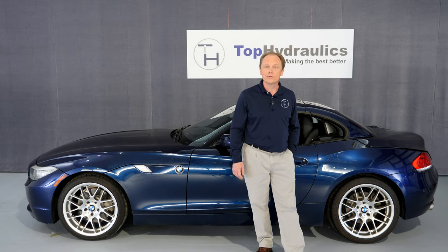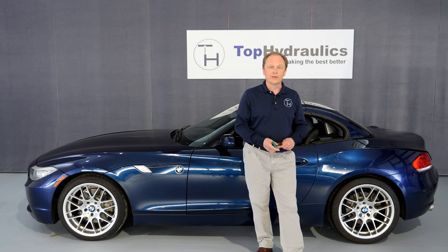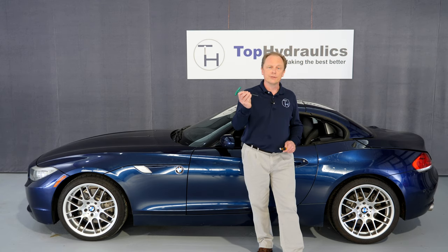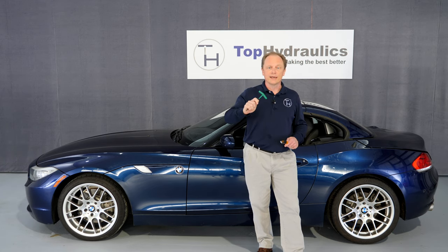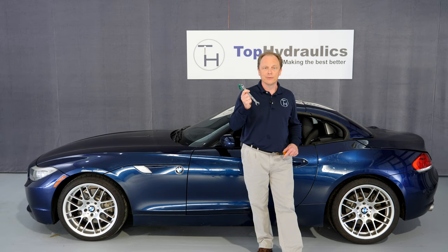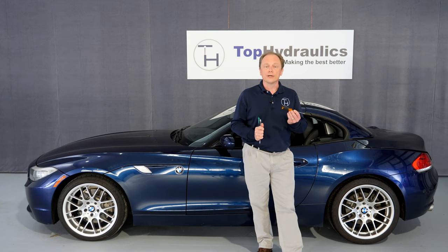It takes some basic tools and you can get the job done in about a half an hour if you have a little bit of self-confidence. And I believe this video will give you that self-confidence because again the job is easy. The tools you need are a Torx T25 wrench — it does not have to be this style, it can be just a basic angled one. A 13mm wrench — half inch will do in a pinch, but 13mm is the wise choice; it's a BMW, everything's metric — and a small flat screwdriver.